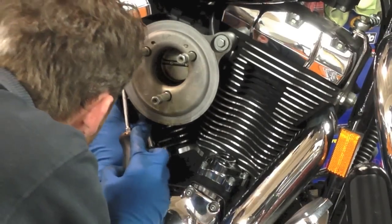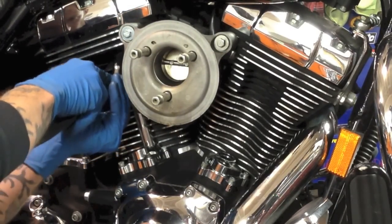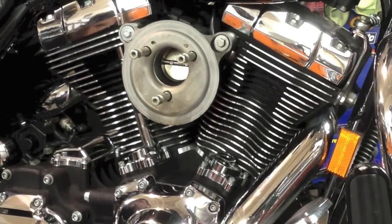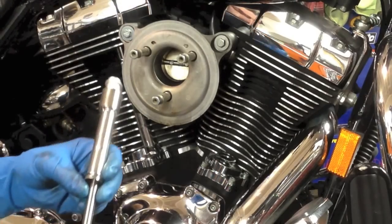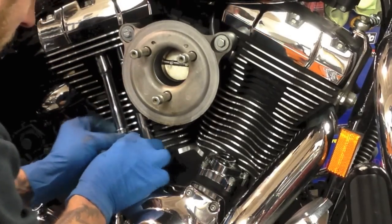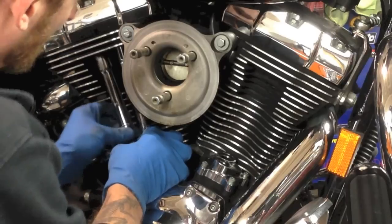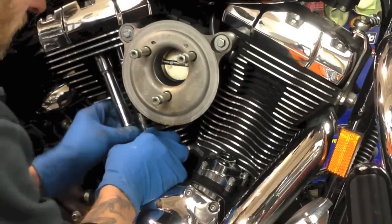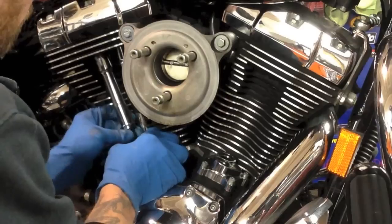Now we've got our push rod in. Push the tube up in there — wedge the cover in, push it up, and push down on the top of that cap while you push it in. Put the o-ring in the bottom for the exhaust push rod — I've already marked it as the longer exhaust. Same thing: slip it up in there until you're in the rocker arm. If it won't go in, you're not in the rocker arm. Turn it out the same way. After you're done with this cylinder, wait about ten minutes before you turn it over to do the other cylinder, and find top dead center again.